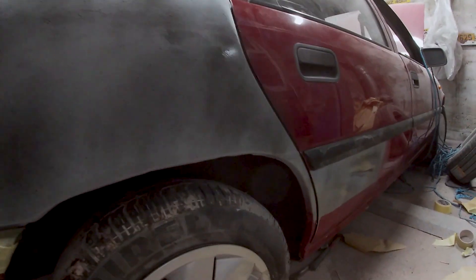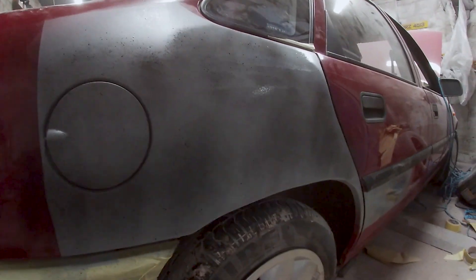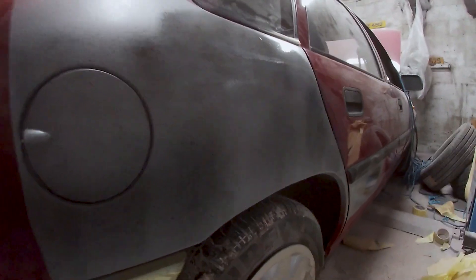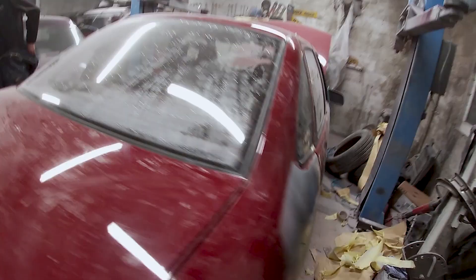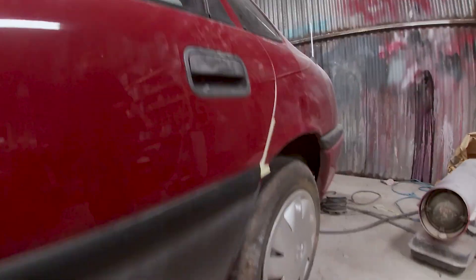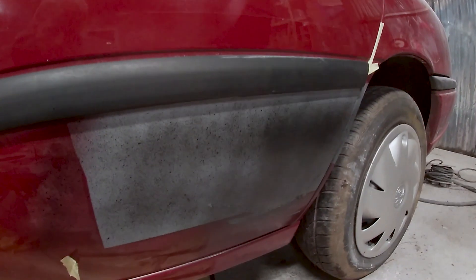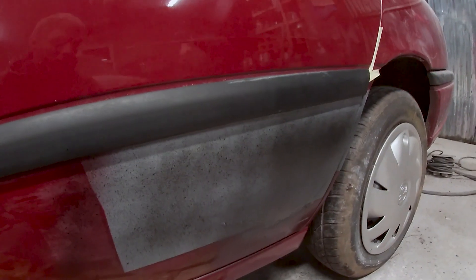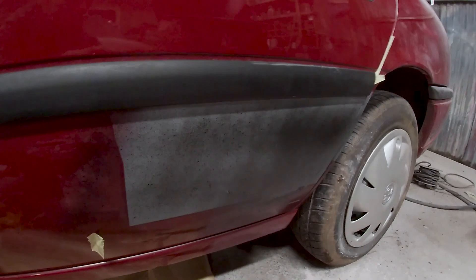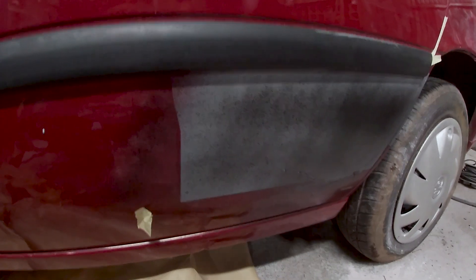So we have it guys, we have our primer. Finally - looks not too bad, I threw it on a wee bit too heavy. As you can see there are lines in it and stuff, but don't worry about that - we'll block all that into shape. We've done two skims and it was actually alright. The other side - we've got a wee run in the primer because I just threw it on, but it's black so it's grand. I'll just put a wee bit of black in the gun and flick it over. Now people probably ask me what do I mix this primer at - four to one, so that's four parts primer and one part hardener. In the next video we're going to be blocking this down and painting it, so hopefully we'll get that out next week.